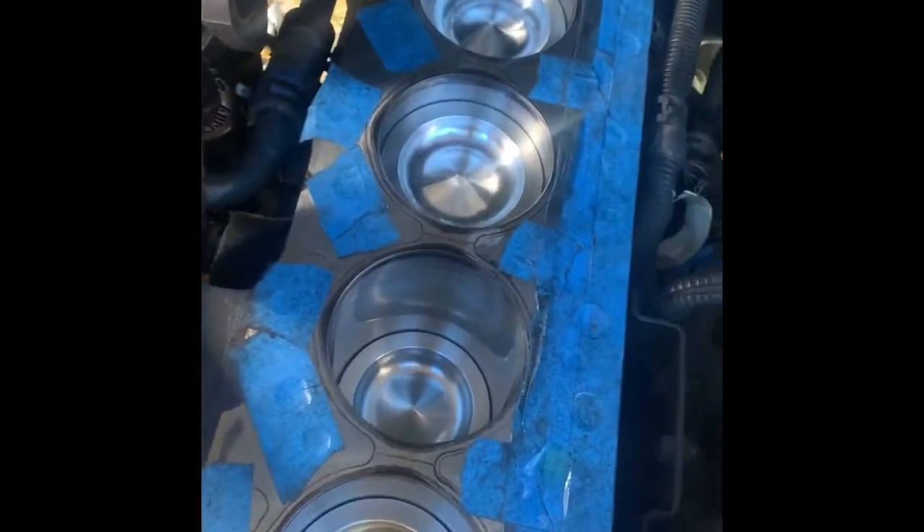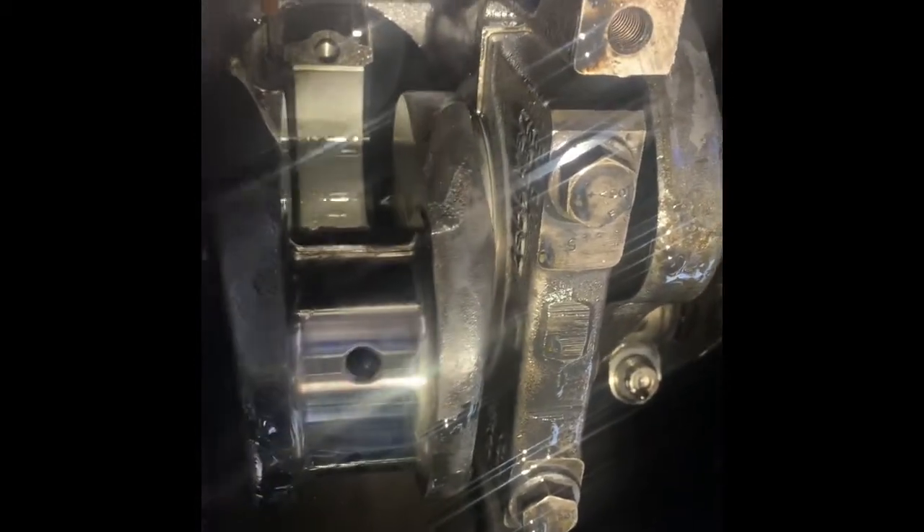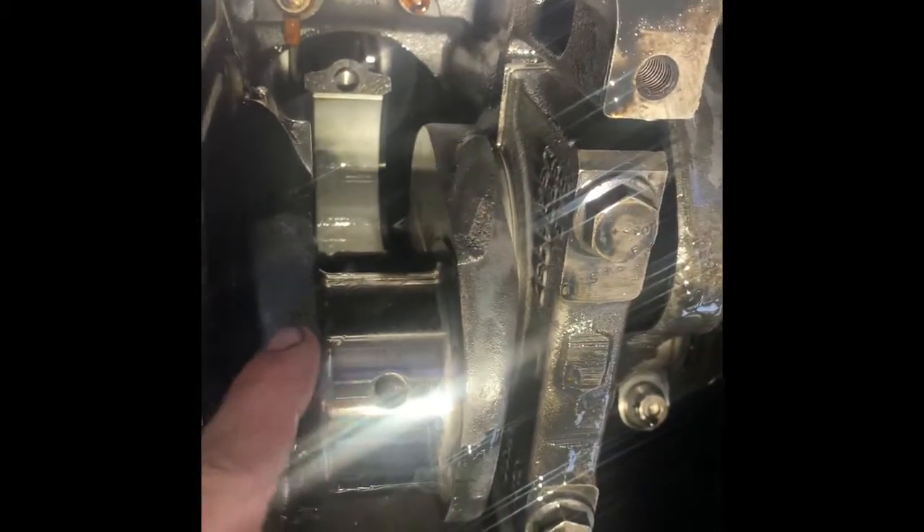The 2004-and-a-half Cummins 5.9 in-frame overhaul is going really well. Under the truck, cylinder five's rod is up there with the new rod bearing. I have the piston rings compressed with the ring compressor and I'm slowly guiding that rod down square with the crank journal. This is super important because of the piston oilers or squirters up here - the rod has a tendency to slide on the wrist pin back towards the squirter when you hang the rod down in there. Tap the piston very slowly and carefully.